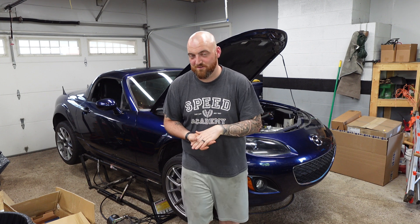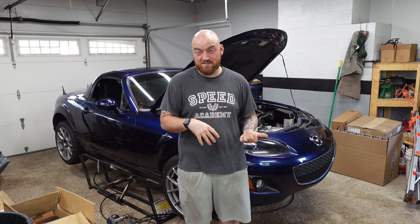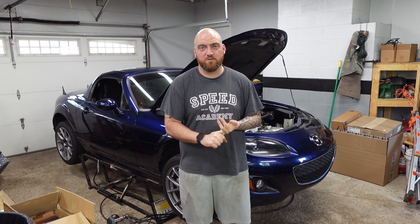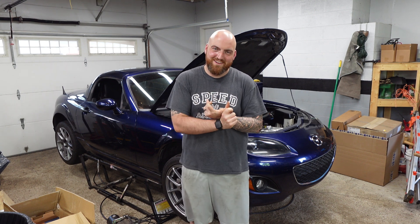So this video is literally just an introduction to a new product that we have on the site. We're calling it the Miata forged engine build in a box. You pick your engine — currently there is Long Nose 1.6, NA8, NB1 which is your BP4W, and NB2 which is your VVT — best motor ever. We will be adding the short nose crank version; it's just that there are some variances we have to work around.